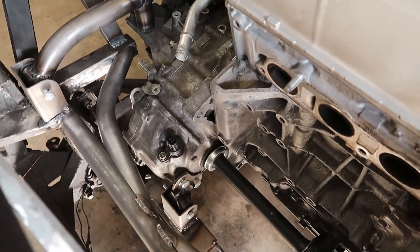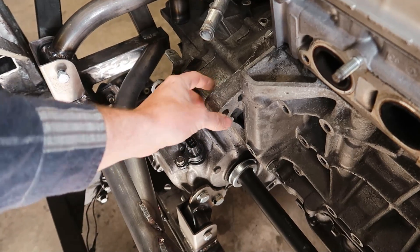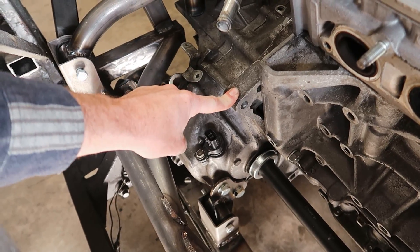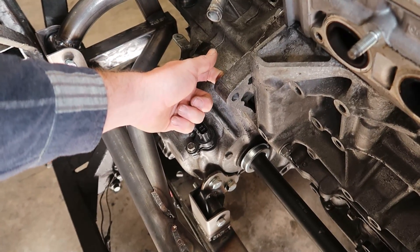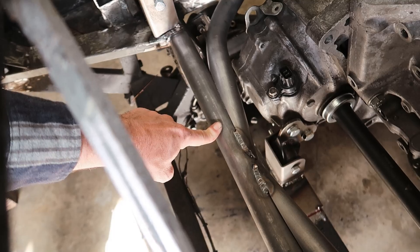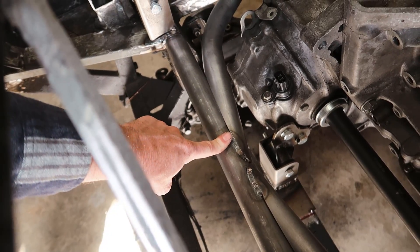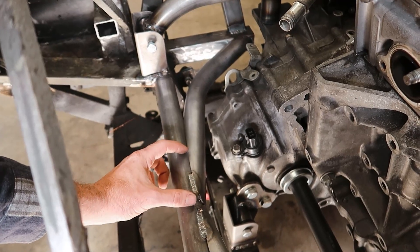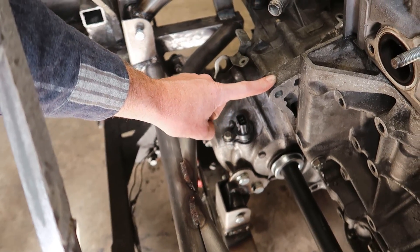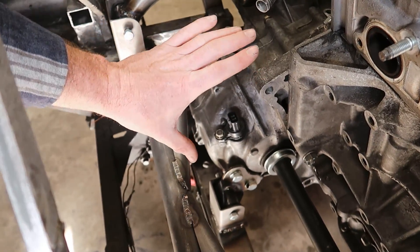So we're going to start beginning to end, but before we hop on the computer and build this part I'm going to show you guys what we need to do on the car. There's a mount that hangs off of the transmission itself — it's part of the bell housing and this is a factory mount from Honda. We want to build an arm that goes from this 14 millimeter hole down to the chassis member that we welded down here, and that's why I put this chassis piece here instead of the previous one that was several inches up and further back.